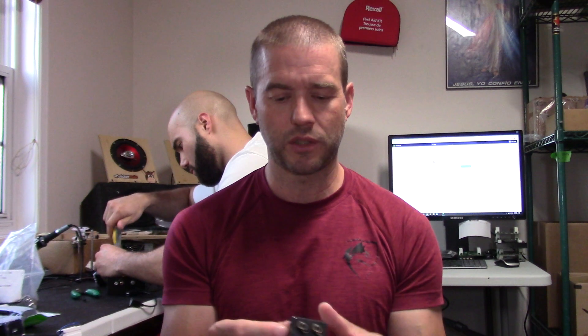So, improvements in the Mark 1.5 kit. One of the things — for whatever reason — we're getting increasing amounts of reports coming in around noise, static, or electrical on the car's audio system. Now, for us, we're not creating that noise coming through the system. Traditionally we've been packing in the SNI-1 unit from PAC, and essentially what it does for most vehicles is filter out any kind of noise coming through the headphone jack of the tablet going through the electronics of the system.